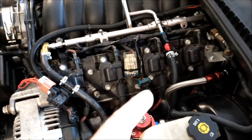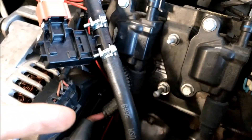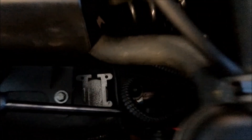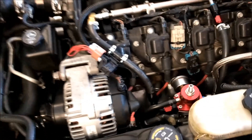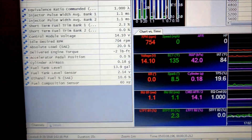That one is really close by so I just routed it up through there and it pops out right there. The ground wire goes back there, down, and over to this factory ground location. I put a weatherpack shrink-tube ring terminal on it. I checked to make sure the engine still worked and that I hadn't fried my computer — that was good. I made sure I had all my pins correct and fired it up.